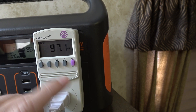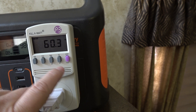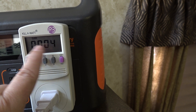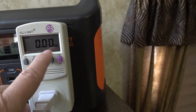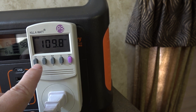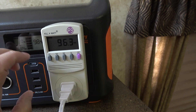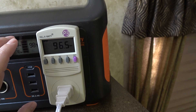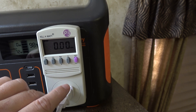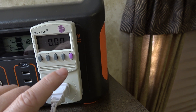That's pretty close — I think this throw is rated for 120 watts max. This button shows cycles per second: 60.3 Hz, which is what this box is outputting. And here we have kilowatt-hours and how long we've been measuring — that's four minutes so far. Over time this will show how many kilowatt-hours it's using. You can see it cycle because this electric throw has a thermostat in it, so it cycles as it heats up. The kilowatt-hours would be really useful if you ran it over the course of, say, eight hours — it would show you exactly how much energy it used.